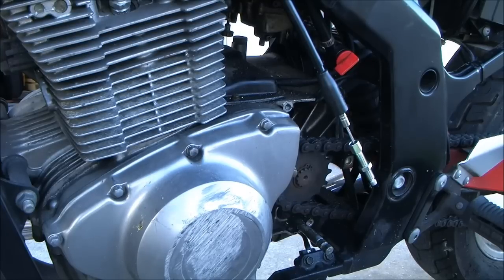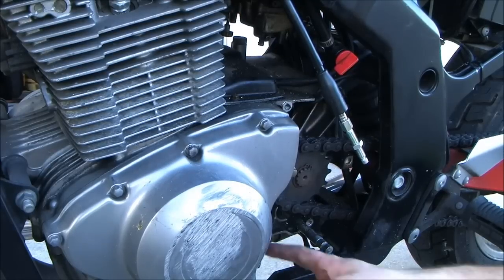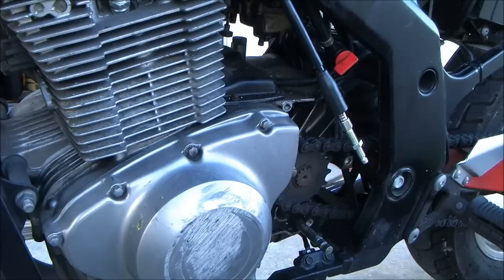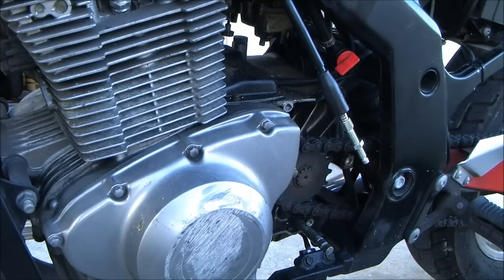You have to have the clutch in to start it. Kickstand, if you put it in gear, even if you've got the clutch pulled, if the kickstand's up and you don't have the clutch pulled in, it won't let you start it. Or no, it'll shut it off if you don't. Every once in a while, if my kickstand's up and I try to start it, or if my kickstand's down and I try to start it, it won't start. But sometimes it will. I thought we bypassed that.